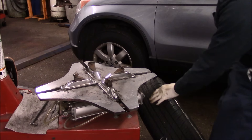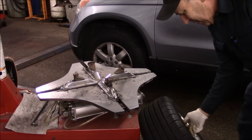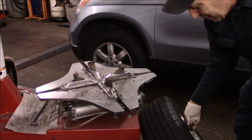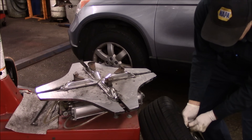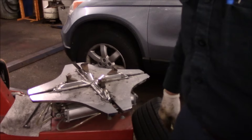Next we're going to let the air out of the tire. Now you may remember me telling you about this Coates machine I bought — the piece of garbage Baseline 200. You can hear that air leak. This thing is still leaking and Coates still didn't call me back to resolve the problem with their equipment. Just want to give you that update. While the air pressure comes out, once it empties, we're going to mark the tire where the valve is so we put the tire back on in the exact same position and don't have to rebalance it.